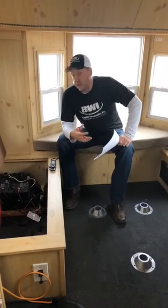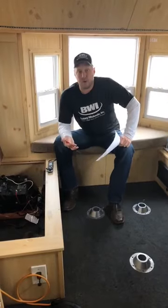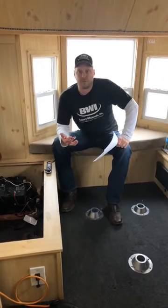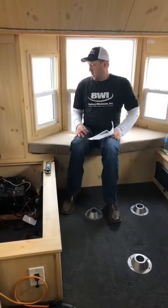What I'm going to end up doing is hooking the amp meter up to the battery bank through the positive cable, and I'm going to show you what the amp draws are off of everything that's running. Then we'll also go out and plug it in, and watch with all the loads that are on and the charger that is running: are you gaining voltage or are you losing voltage with everything that's running? Okay, so let's take a look at the amp meter I do have here.